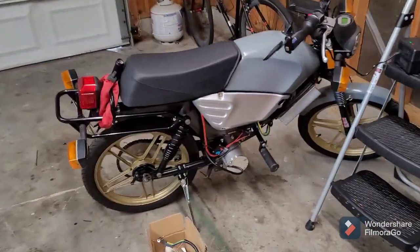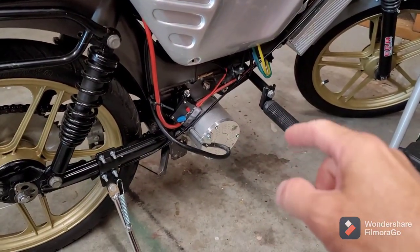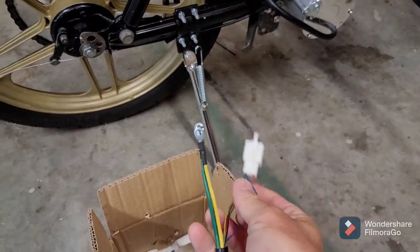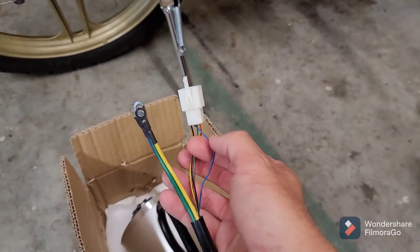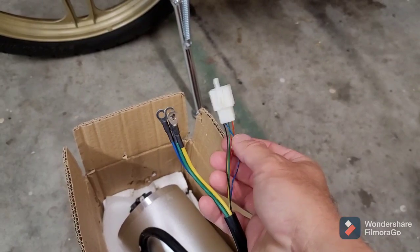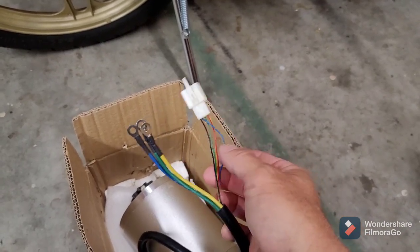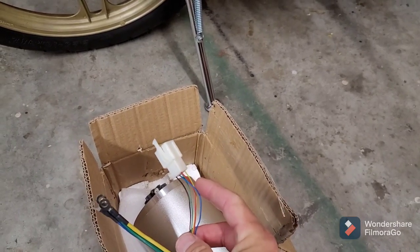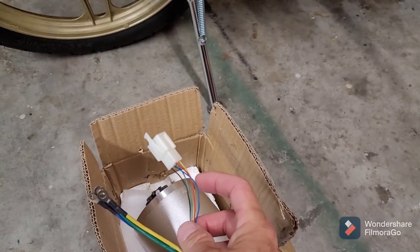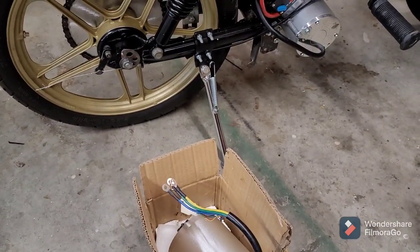My main task for today is I'm going to get rid of this motor right here. I'm thinking it has a defective hall sensor. I've opened up the back before and tested each of the hall sensor wires. It looked like there's a blue one — I think the blue hall sensor wire was bad. Not the wire itself, the sensor. This is after I took apart this Molex and split all of the different sensors into their own bullets. When I tested each of these wires, I noticed I was getting like a 0.4 volt, and then as I turned the motor I would get 0 and then 0.4 volt again on all of the wires except for the blue one. The blue one just remained 0 the entire time. So I'm not sure if that meant it was a bad sensor or if it was the wiring somewhere.